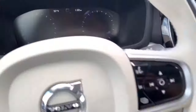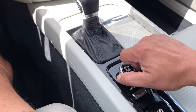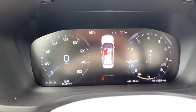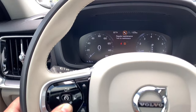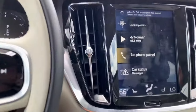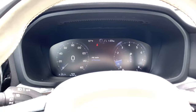Keep holding down the button. Now we're going to start the vehicle — keep holding down the button. Start it. Once the vehicle has started, keep holding down the button, and once you see the exclamation mark flashing, go ahead and release the button. Maintenance has been reset, and it's off the screen as well and off the dash. There you go.